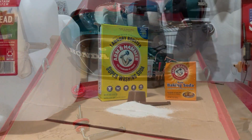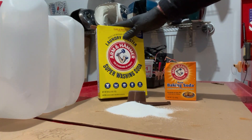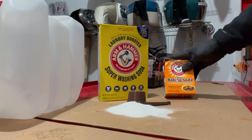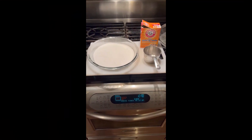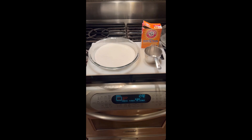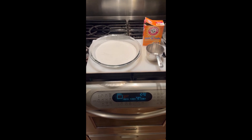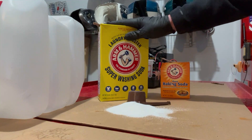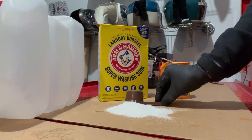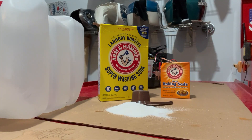For the tank solution I'm going to use just water and washing soda — and of course that's different than baking soda. When I started the project I couldn't find any washing soda so I cooked my own from baking soda. There's a great article about how to do that and the difference between baking soda and washing soda — I'll leave that link in the description below. I did end up finding the washing soda when it restocked in my local store, so I've just been using half a cup of washing soda with a tank full of water, and it seems to be a pretty good place to start.